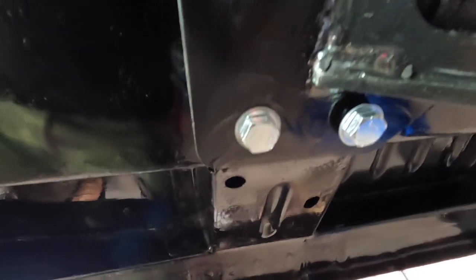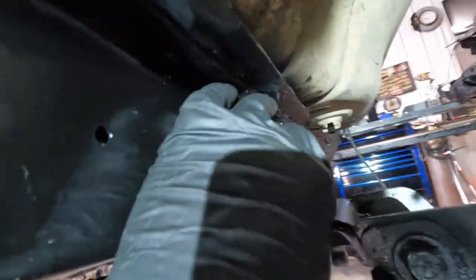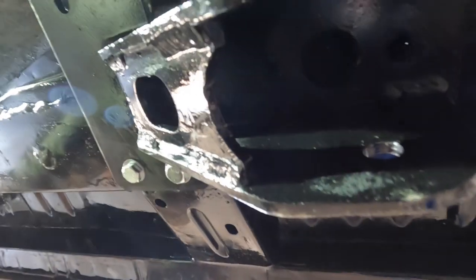12 of them that hold it into place. There's these two here that go in place, two of the existing cross member bolt holes, go up inside the frame rail here. You've got two here. It doesn't take very long bolts for there. You can see that, that pinches that in there. And then kind of like what we had in the rear, except they're smaller ones, we've got two captive nuts that are gonna go up inside here, up through here, and then there's a bolt here and a bolt over here that's gonna go through on both sides, and that holds it all in place and sandwiches the frame in there.